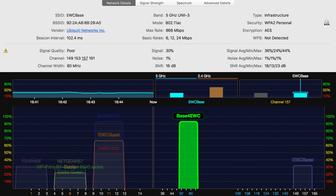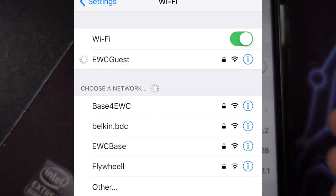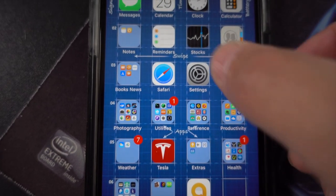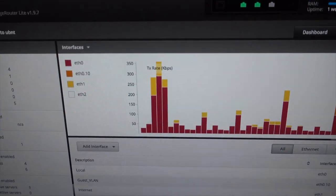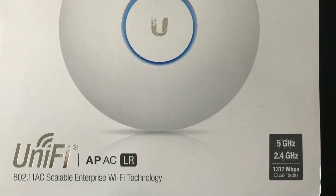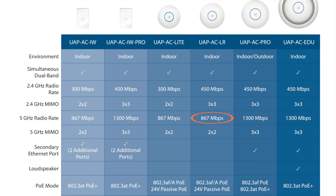Now we can do guest Wi-Fi testing. I'm connecting to guest Wi-Fi on the iPhone and it's got an IP address as expected: 172.16.42.2. Refreshing some applications triggers guest Wi-Fi traffic on the edge router, and you can see orange spikes representing traffic on Ethernet 0 VLAN 10 — our guest network. Regarding Wi-Fi speed, this product declares 1300 Mbps but in fact, as shown, the correct speed is 866 Mbps. If you need 1300 Mbps you'll need the AC Pro. That's a quick review of the Ubiquiti long-range access point and the steps to set up a guest network properly. If you like this video, give us a thumbs up, click subscribe, and share it with your friends — until next time, peace.